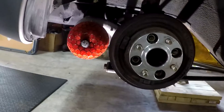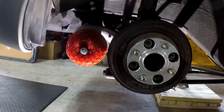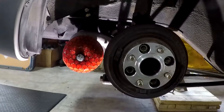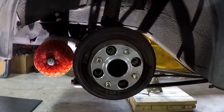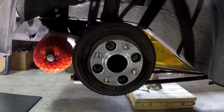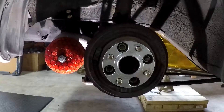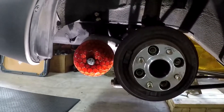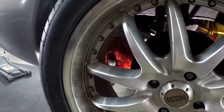As far as water submersion, driving through deep flood water is not a good idea anyway, but with this filter being this low you're going to need to pay attention. Driving through regular rain is not a concern, but navigating any deep water — where you'd normally be okay with the filter up in the engine bay — you'll have to give some thought to it. You could route the filter back towards the rear of the car and get it a little bit higher, but right now this is what we're going to run.